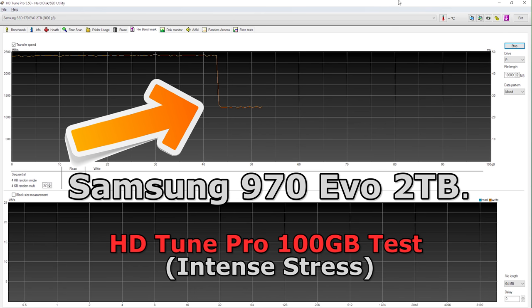This is probably due to Samsung introducing what they call TurboWrite — they promise up to 72 gigabytes on this two terabyte EVO variant. However, in HD Tune Pro, the scores were actually dropping at 44 gigabytes, not 72 gigabytes as advertised. So the consistency of this drive is a little bit off, which is actually very important when it comes to an NVMe drive.